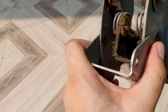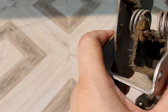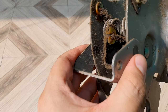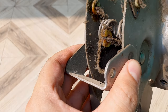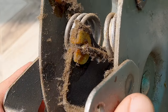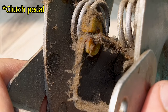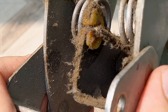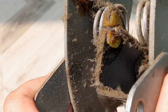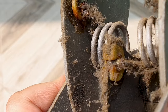I don't really hear the noise. Now if you have a look over here - let me focus it - if you see this here, the clutch is currently in a pressed position. So when the clutch is coming back up, that's where the noise mainly occurs. You can see that it's skipping and I can feel vibration.